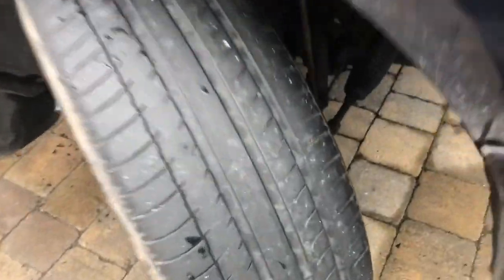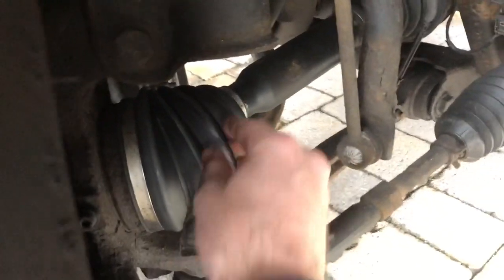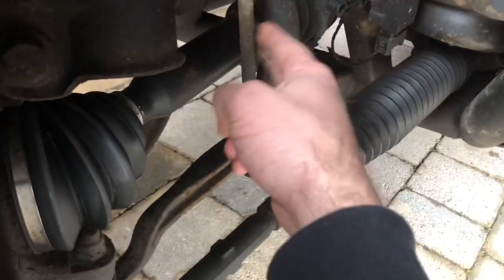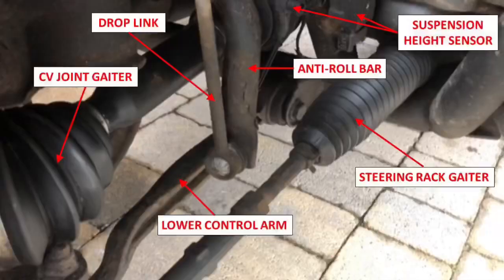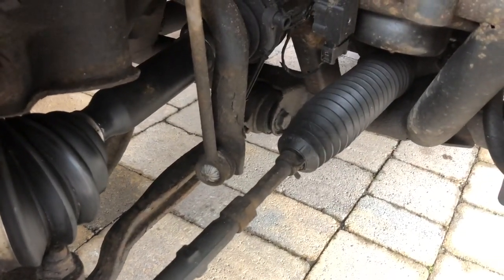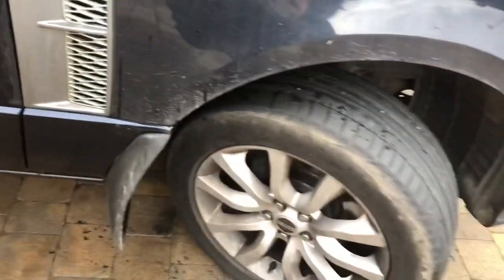You're now able to see a little bit more. You can get right in here and start to have a look at all the boots, all the connections. Are they split? Are they perished? Here's our steering rack and there's our boot — it feels pretty good. As for the drop links, you can have a look at what condition these are in. Any play in any of these at all, and up at the top as well. Have a good look around. You don't have to be a qualified mechanic, but you can have a good old look. Does something look loose? Does it look worn? Are any rubber parts split or perished? Have a good look at the wheel as well while you're there, and do it on the other side.